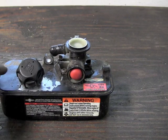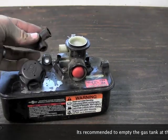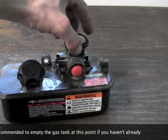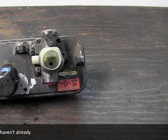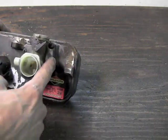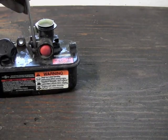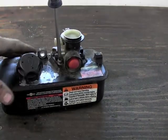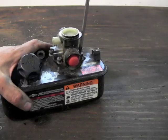So now we're looking at the carburetor — it's attached to the top of the gas tank. Now we're going to remove the little rubber boot and set it aside. You also have a gasket on top of the carburetor that we want to remove and set aside. In order to remove the carburetor from the gas tank, we have three screws holding it on one side and two screws holding it on the other — they're simply Phillips head screws, so we're going to use a Phillips screwdriver to take them off.